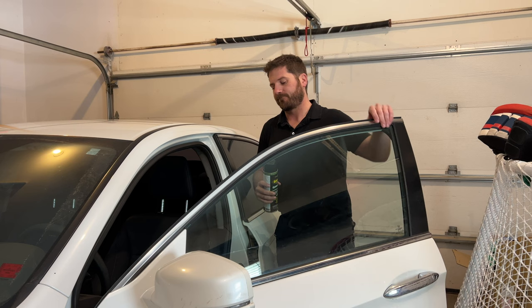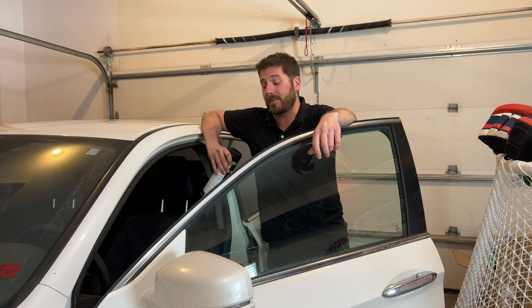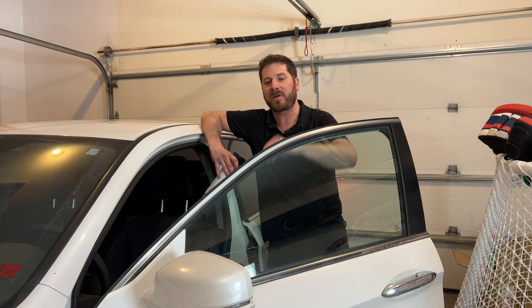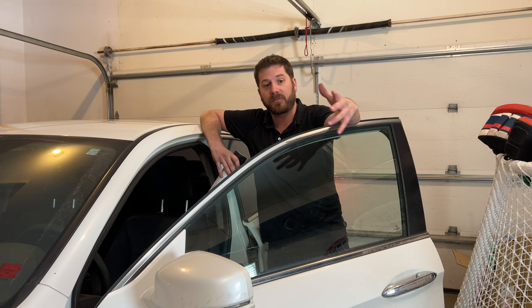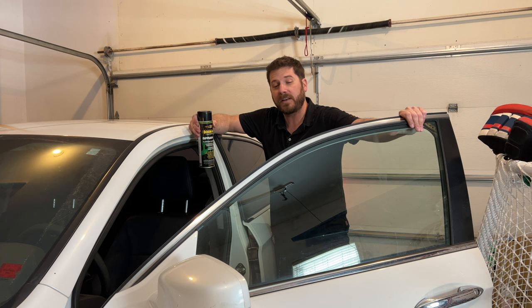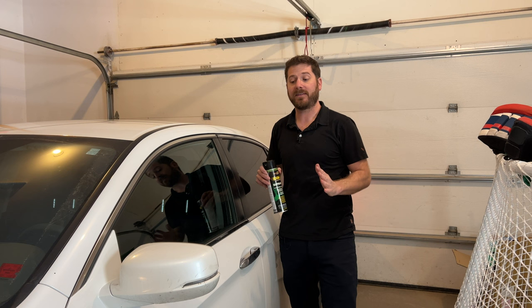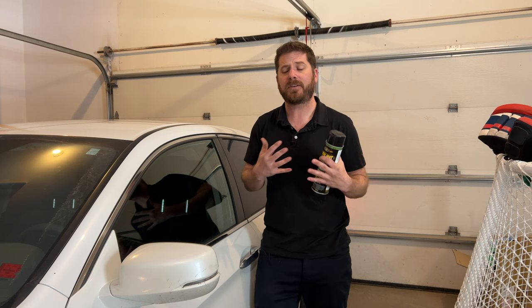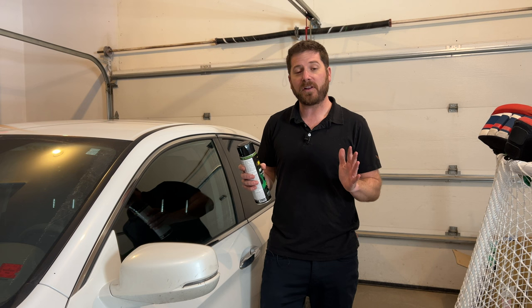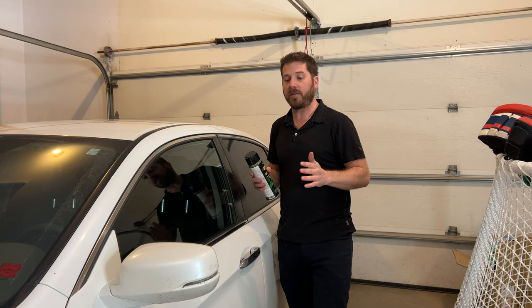The spot that makes the biggest difference for road noise is the floor. If you have a high-end luxury car, it's not really worth ripping the floor out since there's already quite a lot of sound deadening material there. But for an entry-level vehicle, removing the seats, removing the carpet, and adding sound deadening material will make your car noticeably quieter — it just takes a lot of time and effort. I'll have links in the description to the materials I'd use, and good luck sound deadening yours.